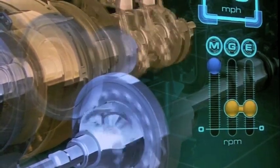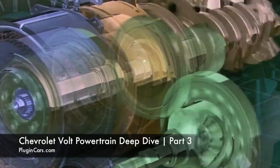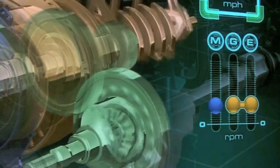When the driver is making demands that aren't for very heavy acceleration or passing maneuvers, we are able to transition out of that high-motor-speed mode and go into combined driving. When we do that, there are a lot of motions: we release the motor and the generator, hook the generator to the ring gear, release the ring gear from the case, and spin the generator back up to connect it to the engine. In this situation, the motor speed is down significantly — less than half what it was in the prior power flow. The engine and generator combined are operating at a fairly moderate speed, and this is worth about 10 to 15 percent efficiency in cruising-type conditions — well worth our efforts.